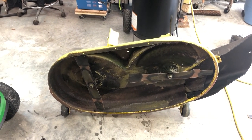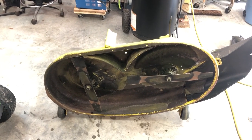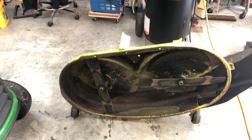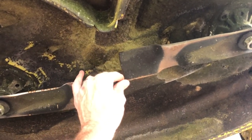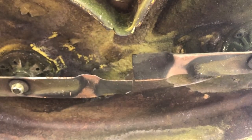Here I've got the deck off and stood up. Looks like a typical underside of a lawnmower deck. Usually when either the blades or the deck is bent, one of the ways to test that is to rotate the blades so that the cutting edges meet in the middle. And if you've got an issue, these will be different heights. And as you can see, my two cutting edges right there are the same height, so that would make you think that everything's good.